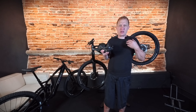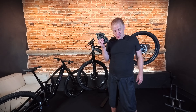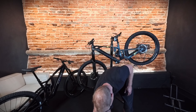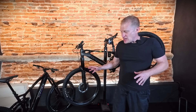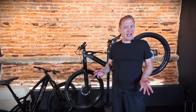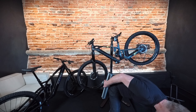The Bosch motor with the pedal arm comes in at 3.09 kilos — so about 280 grams difference. The total weight difference between the Avinox system and Bosch is around 500 grams, which is not a huge amount. It's like putting a water bottle on the bike and asking if you can feel the difference. Out of interest, we also weighed a Shimano motor: with the pedal arm it comes in at 2,865 grams — around 50 grams heavier than the DJI, which is imperceptible. This got me thinking: DJI have been marketing the Amflow and T-Wing heavily on weight — claiming the most powerful motor and system on the market. But is it all about the motor, or is it about the bike?